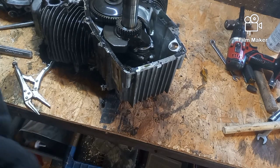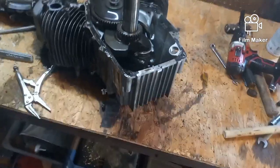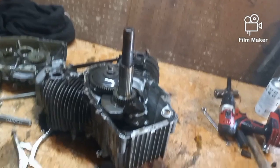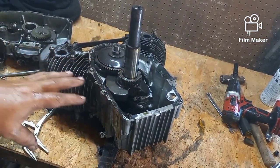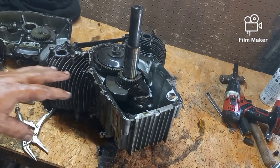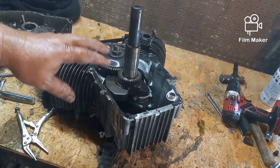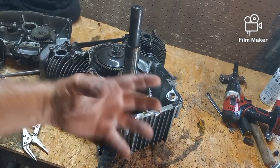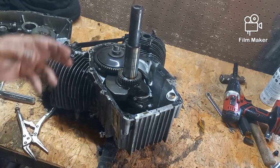That's oil changes that I keep that gets recycled. And that's a good tip for you. If you have a situation where you have an oil leak and you need to find out where it is, why fill it up with fresh, brand new oil at $7, $8, $9 a quart these days? Use your old oil. You can strain it through a coffee filter if you want to make sure that there's nothing in it, as long as it doesn't have any metal shavings in it.